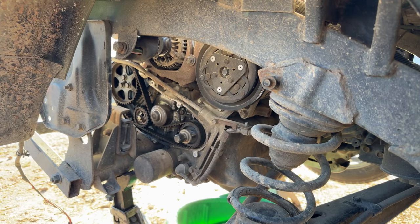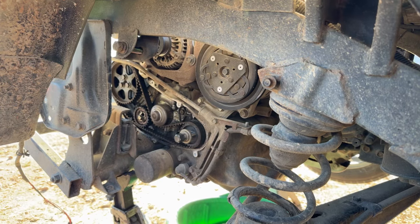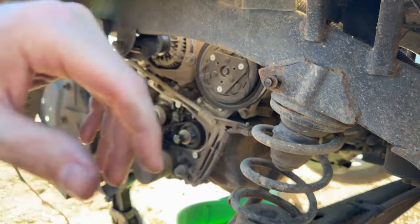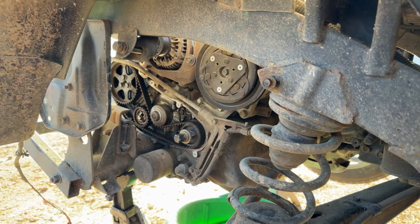Yep, 2013 Legacy has a vibration from the center console and steering wheel going at highway speed. Replaced front tires, got an alignment. Tire balance issue persists. Tips, I would start checking control arm bushings, ball joints, and tie rod ends, something probably in your suspension going on.